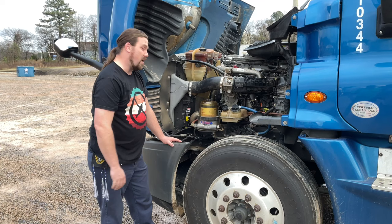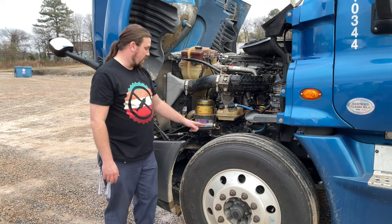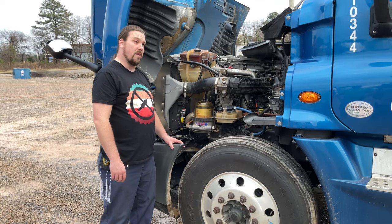My springs, there are none broken, missing, or misaligned. If a quarter or more are missing, it'll put my vehicle out of commission. My U-bolts are securely tightened and they're not broken or missing, and my shock absorber is securely mounted and not leaking.